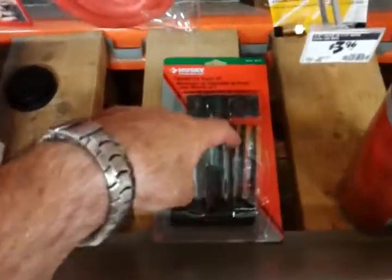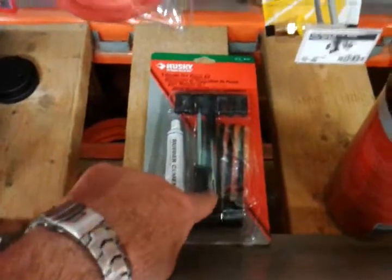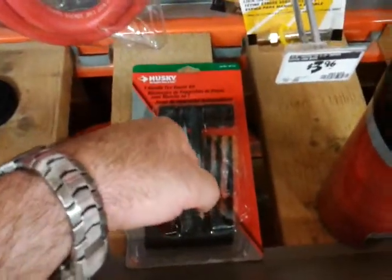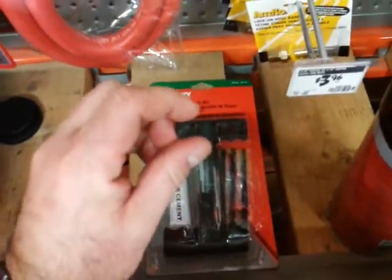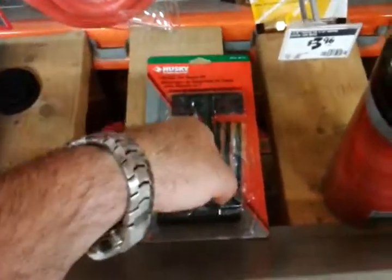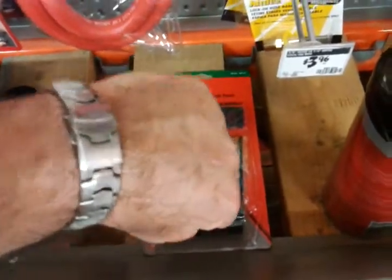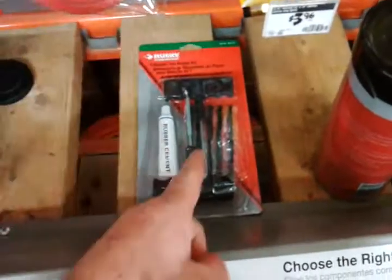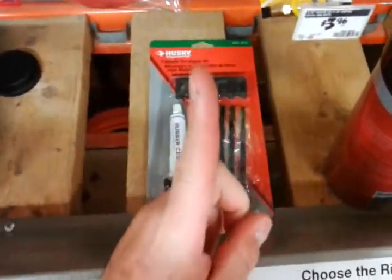It's really sticky. So then basically you take this guy, you stick it in this giant sewing needle head thing, and you plug it in the hole. You push it in about half inch, quarter inch to stick out the top. I'd say probably about a half inch or so. You push the tool in there, you give it a half turn, you disengage it from the rest of it, you pop it out of the hole. It leaves this thing folded over in like a V shape, tucked into the hole.